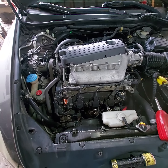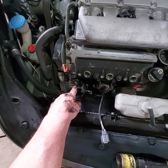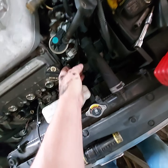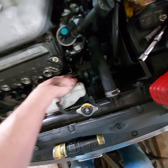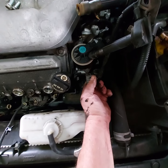We'll have to unhook it from the EGR valve to give us enough slack. I went ahead and unhooked it off the battery load cable — there's a pretty good rubber grommet on there. I didn't unhook the battery, but if you think you're going to short it out, go ahead and unhook your battery, pull the boot back on the regulator connector, squeeze it, and it'll slide off. The connector for the coil pack clips on this little metal bracket on the bottom side.